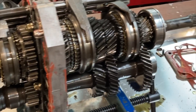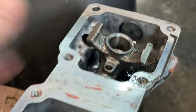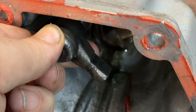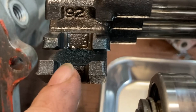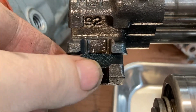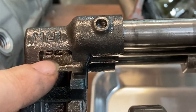Have you ever wondered how a Mazda Miata transmission works? The gear shift lever connects to this little cup here. When you move the shift lever, this little prong here can move in and out and left and right. This goes in these slots here — three separate slots for your shift forks, these three rods. Depending on which gear set you select: this middle one is your third and fourth gear set, the one on the bottom is fifth and reverse, and the one on the top is first and second.